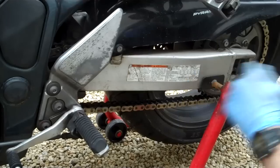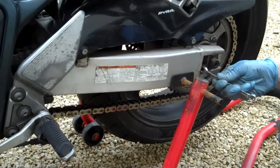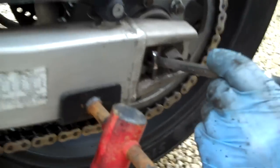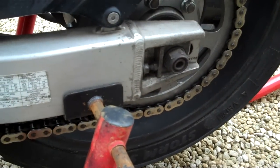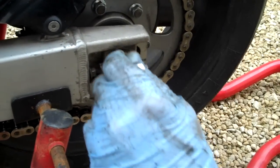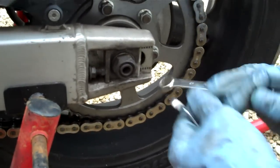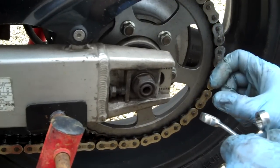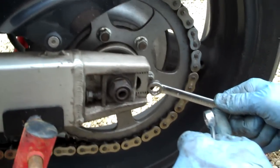We're going to adjust this — it's still a little bit too much. You've got little marks on the swing arm which you can use. If you really want to be accurate, get a steel ruler and measure between that face and that face and get those measurements the same on both sides. A lot of people don't go by these marks thinking they might be out, but they're actually quite accurate. A more accurate way is to measure between the back of the carrier block and the back of the swing arm. Just get them even with where they are.